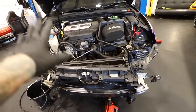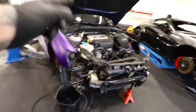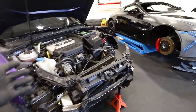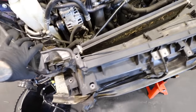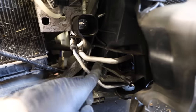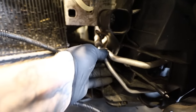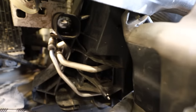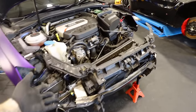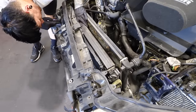This is the most stupid design ever - we've got the radiator, then the intercooler which we're going to be replacing, and then the aircon condenser at the front. I removed the fans from the back of the radiator just to give me a little bit more room. We would be able to remove this full plastic section with the crash bar if it wasn't for these two aircon pipes - they've got gas in and I don't fancy releasing that. So I just had to work my way around not being able to get that front panel away from the car because of the aircon condenser.